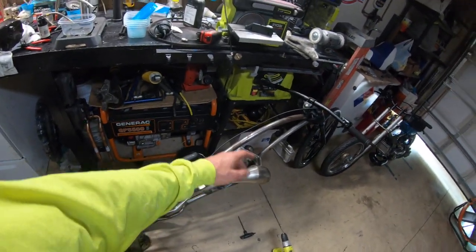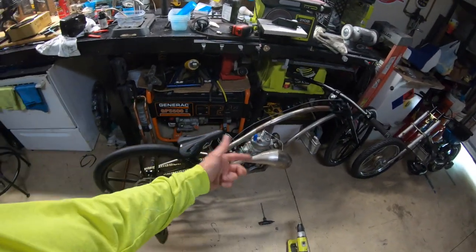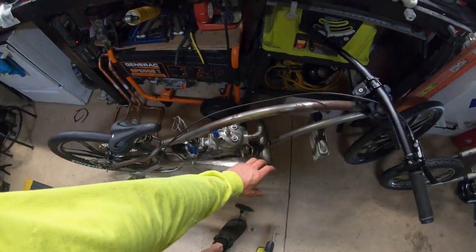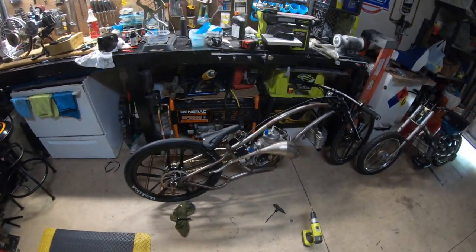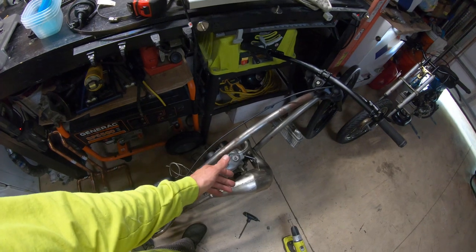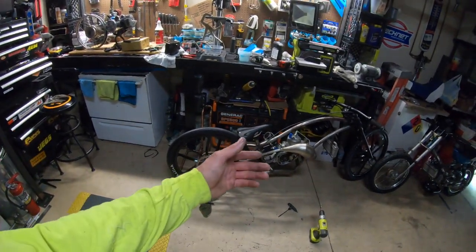The pipe was also used off eBay. I filled the entire pipe with water, plugged each end with a latex rubber glove taped tight so it couldn't leak, filled it from one end, then put it in my freezer oriented so the water sat at the expansion chamber where it had a huge dent. It worked perfectly — the only problem was I left it in the freezer too long and it exploded on one side. I already uploaded the video of me repairing that blowout.